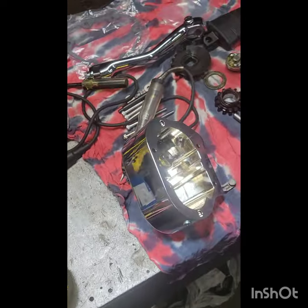So what you're going to want to do is put a little bit of grease into your bearing, sandwich that bearing with these two washers, put it on that end. It also comes with a little clip too. So we'll do that, and then we'll put it in. So that's what she looks like, all put together, pretty much like the old one, but just goes right in there. And that's her. That's all she wrote.